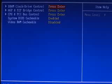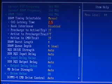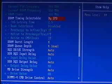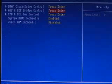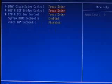If I go back to the top to the memory, you've got a few memory timing options here. You can go by an SPD option, or you can do turbo or ultra, or you can go manual where you can set all the settings manually. Within the AGP and P2P bridge control area of the advanced chipset features, you can change the AGP size as well as fast write — you can enable or disable that. There's also a feature called enhanced AGP performance which you can enable or disable.